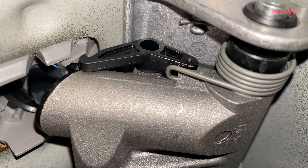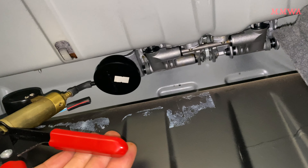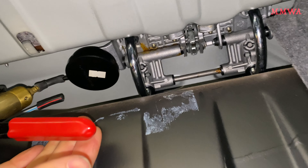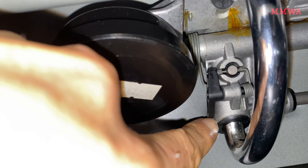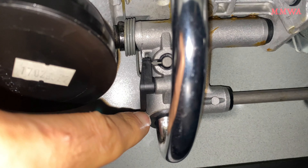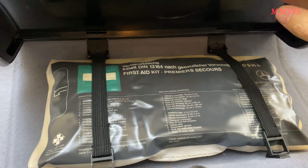The headrest can't be removed with those covers in place. As a bonus, you can get to see the operation of this mechanism now with a hand vacuum pump, just to make sure that's all working. You can see those locking mechanisms more clearly — they're just pulling out pins in the end of those legs. That's the pin being retracted. On the plastic lever, you don't remove it with it in the retracted position — you have to do it in the upright position. These are easily accessible at the top.